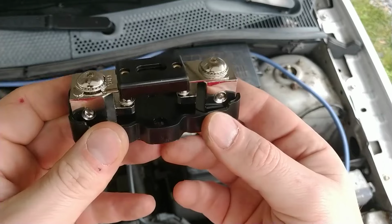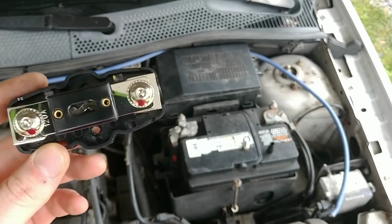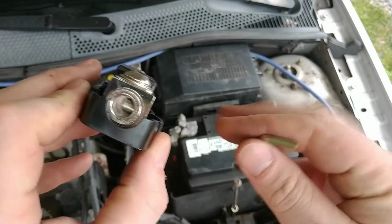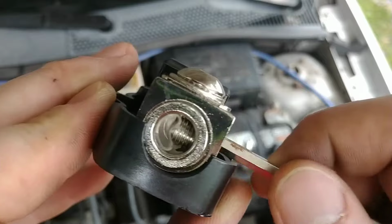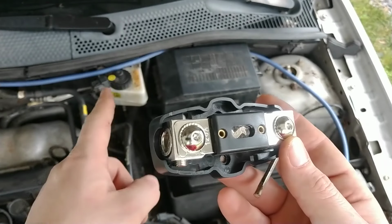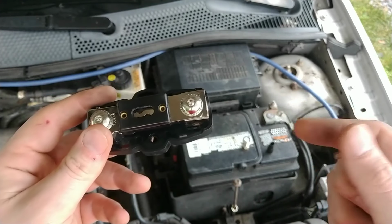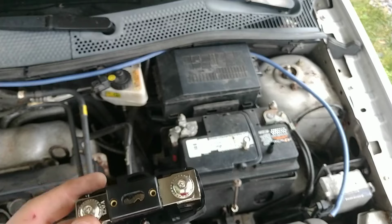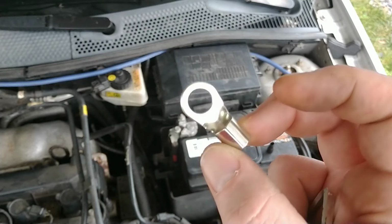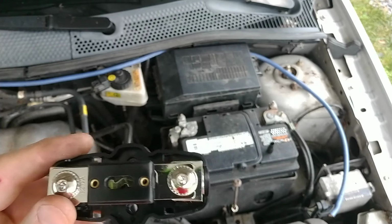And so the way you do it is you'll mount this, screw there, screw there, or you could zip tie it somewhere, whatever it is you want to do. Then you loosen this up right here, and as you do that, you'll see it'll allow you to slide your wire in there. So how this works is, we'll cut that wire, run it into this, take the other end of the wire we cut, run it out of this. Then the end of the wire will go on a connector just like the back did, which they did supply. Crimping is a little difficult if you ain't got the right tool. That will set on our battery terminal. So let me get to that.